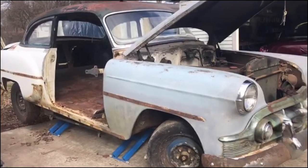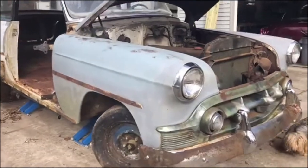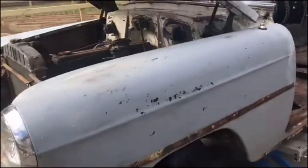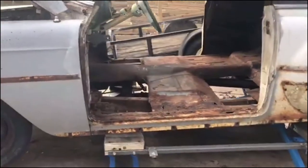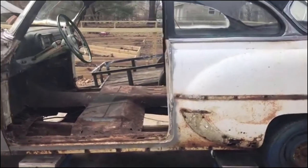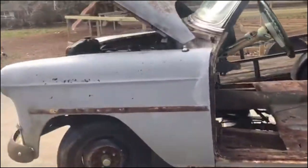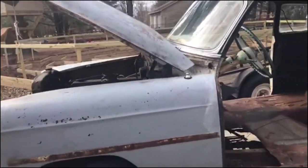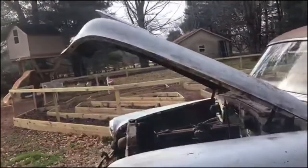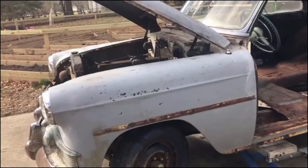But I'm going to put the body on a rolling cart and roll it back into the garage, and we can do the body work kind of in the cold. It's January. We're about to have some pretty cold days setting in, but that's going to give us time to come inside and work on that. And then it's going to take the frame. We'll park it back out here in the yard and work on that separately, and get our new floor pans put in. We can get our new body, our quarters and all that stuff done. But if you take this whole front clip off, the car doesn't take up nearly as much room in the shop anyway. So we want to go ahead and get that thing taken off. We'll get the hood taken off as well today, I think. But that's what we're on to today.